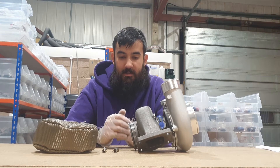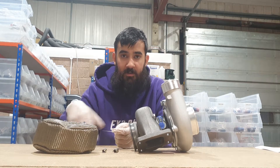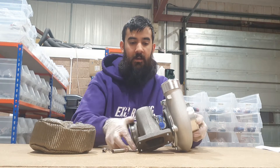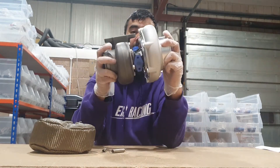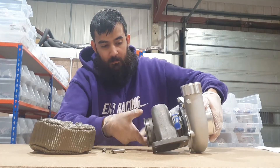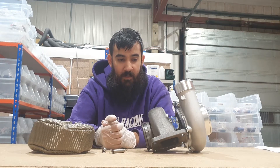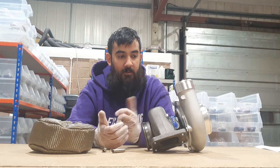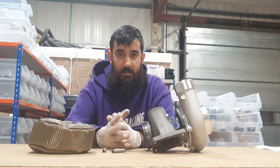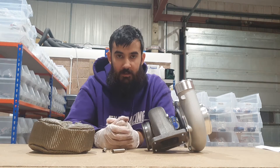Another benefit is that due to the massive heat that comes off the turbocharger, you have vital components nearby like oil lines and water lines — the turbo we have here runs both oil and water cooling. You don't want any of those lines to split from heat, so turbo blankets help with that. Any vacuum lines near the exhaust side should also not be touching the hot side.